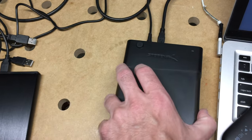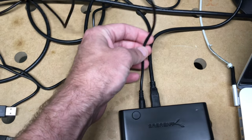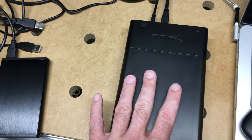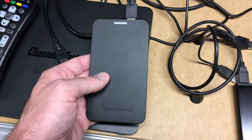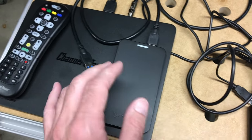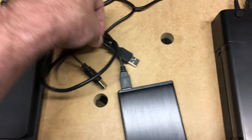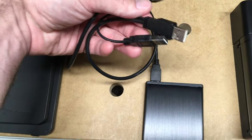I was able to get this drive working. This is a Sabrent enclosure where you can actually just slide hard drives into it — I'll put a link in the description. This one does have a USB and power cord so you have to plug it into the wall and it's kind of big and clunky. It's a really good enclosure but it wouldn't look great under a TV in a media center, so I ordered this enclosure here. This is USB 3.0, but the Channel Master only supports 2.0, so this didn't work. This drive is 2.0 and it does work, and it actually has two USB plugs — I'll plug both of these in.